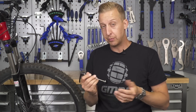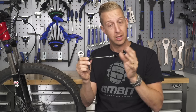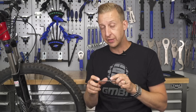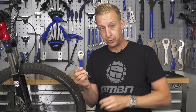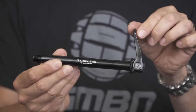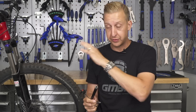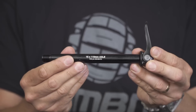What exactly is a bolt-through axle? These days they're often referred to as a quick release through axle. This is more like a conventional quick release — once upon a time they were everywhere on mountain bikes, but as the technology has developed, they're quite rare these days, although you do still see them. The quick release through axle is essentially a very beefed-up version of this, because bikes now have suspension, often front and rear, and these form part of the structure of the frame to keep everything stiff and strong.